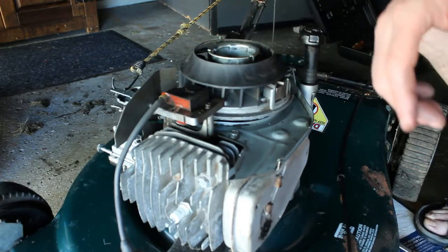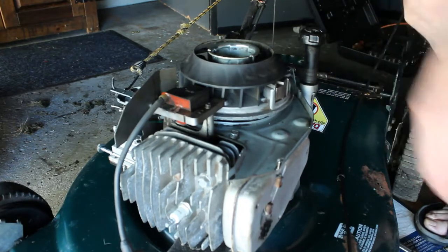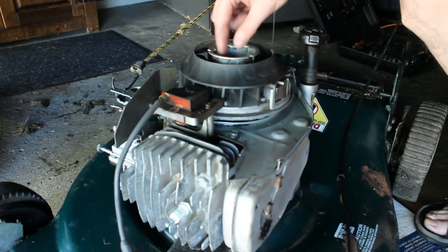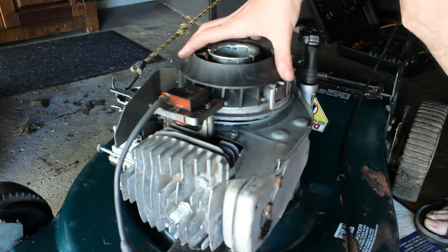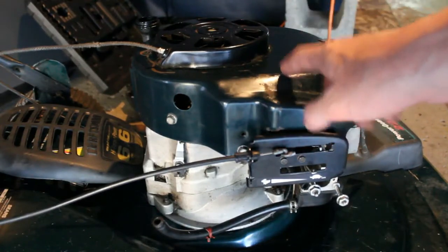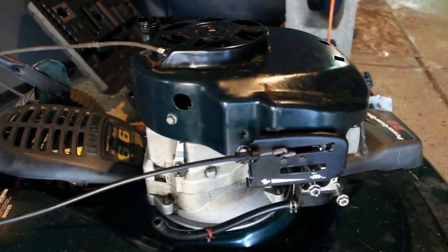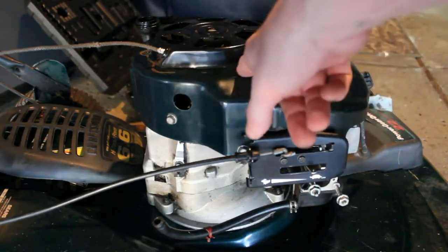And we'll get our wood put in the blade to lock it up. And we'll get our wrench, and then we'll start tightening it down. And it should tighten down pretty nicely. Okay, so we've put our cover back on. You just want to make sure the flywheel isn't rubbing if you turn it by hand, because there are some things that run underneath that flywheel.